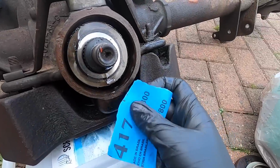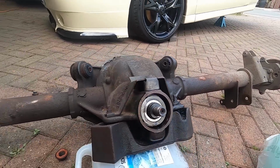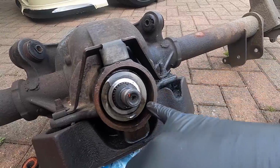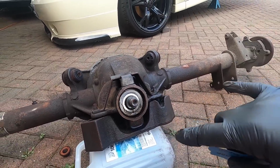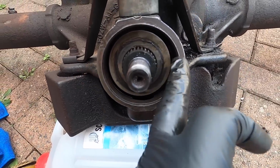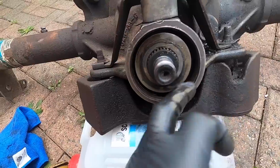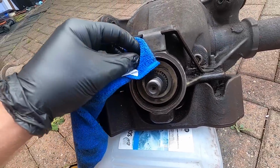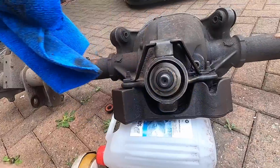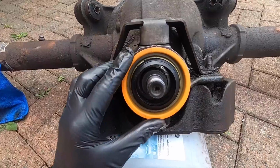I'm just going to get some light sandpaper and sand the shit off where the seal sits, around the outside and just a little bit on the inside of this little ring. Again, I don't know what I'm doing, guys, don't follow me, this is just what I'm going to do. Okay, I've not gone too crazy, but I've cleaned the inside of here, and the outside, so it's a bit smoother, and removed a lot of the oil and the shit, so the seal doesn't get wedged between the oil and the shit. So now we've just got to pop it on, make sure it's flat, and then whack it in with a hammer.